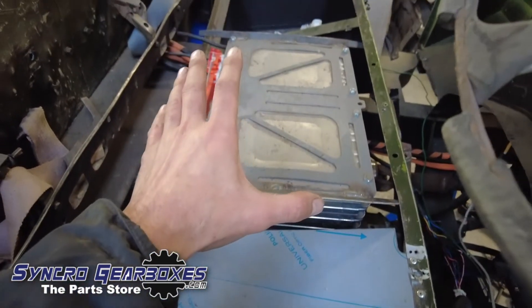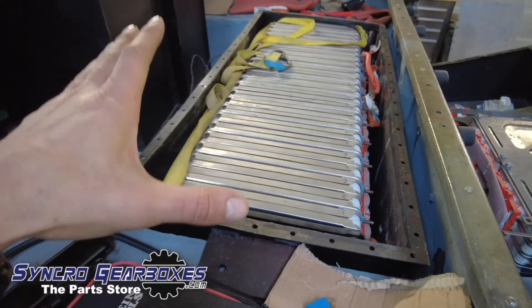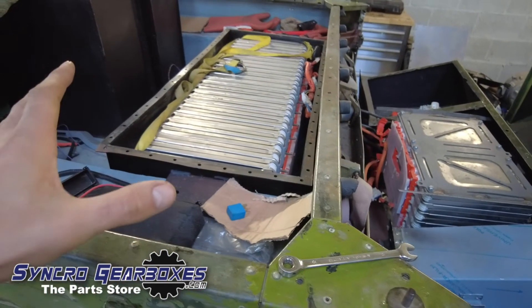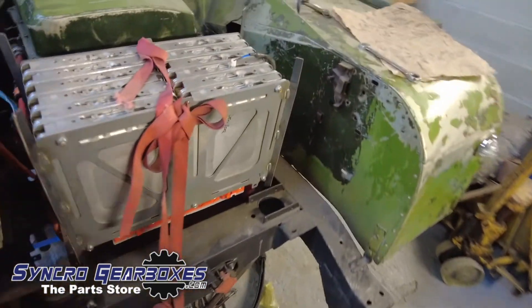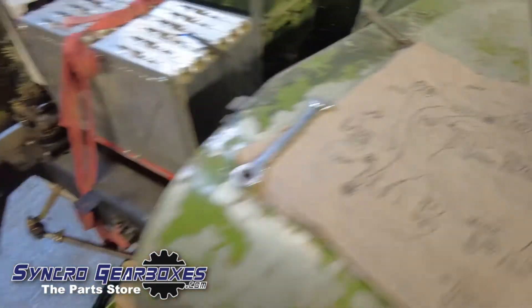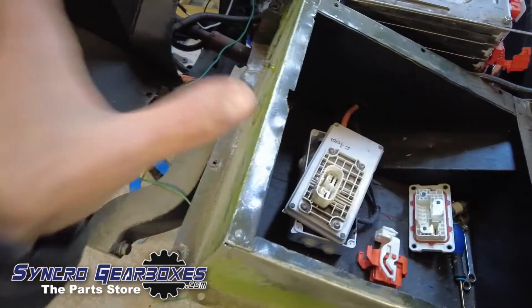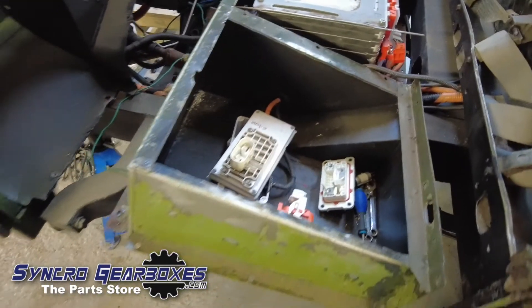This is all the low voltage wiring. You can see the middle battery there in the battery box; underneath the seat box there's our main battery — the larger battery packs in the tub. Up front you can see we've got all our electrical junk trying to figure this out, the front battery pack, our relay contactors, and our service disconnect down here. You've seen a lot of this stuff already, but that's how everything is laid out.